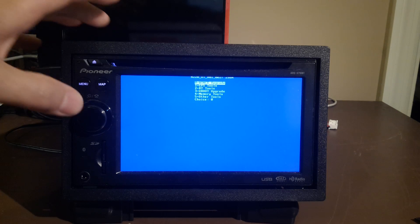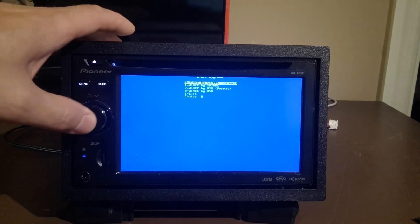If you did it correctly you should be presented with this screen. Once you get to this screen, you have to press the secret password, which almost sounds like the old Nintendo Contra code. So we're going to press in the upward direction — up, acknowledged by a dot, another up, another dot — then down, pushing in a downward motion. Next is the menu button, then left direction, then right direction. That brings us to the menu. The first option here is "Zero WinCE upgrade" — we're going to go ahead and select that, then select "WinCE by SD MMC Format."